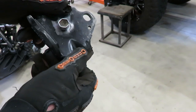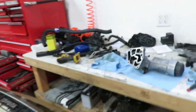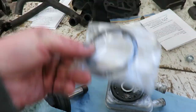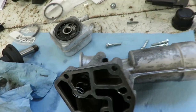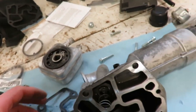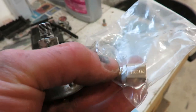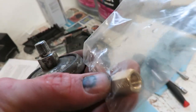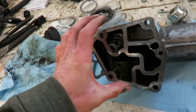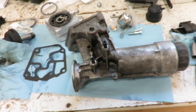They also put a big fat nylon washer underneath the nut on this side, and that helps keep the vibration from running right through the bolt into the frame. We got that motor mount all together, good to go. Got this all cleaned up, going to throw that on. Also got new seals for the cooler and my gasket. We'll get this on and make sure everything clears — the only thing I'm worried about is my pressure switch, which needs a 10mm to 1/8-inch pipe thread adapter. I got the adapter and I'm hoping it's going to fit. I got two ports — either one of these will give you oil pressure. Let's get this on and see if everything fits.